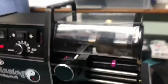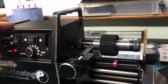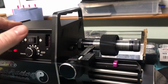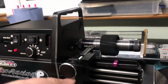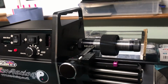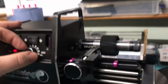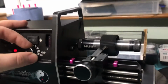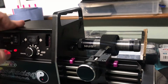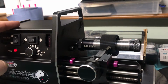So how I do this is I mount the smallest tyre up to the truer, and I move the arm out so it's past, lock it in place. I move the arm so that it's over, in the case of rears, the centre of the tyre. In the case of fronts, I would do it to whichever side was biggest, because the fronts tend to wear in a cone fashion, so one side will be slightly smaller than the other. It's worth watching for. So I move it over the middle like that.